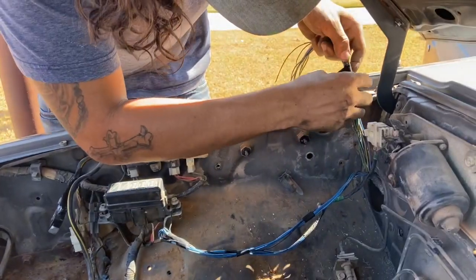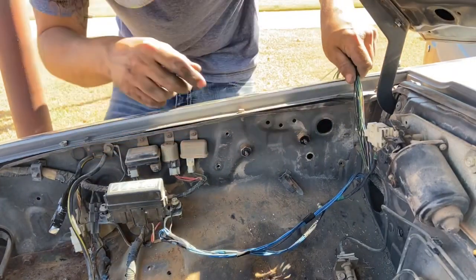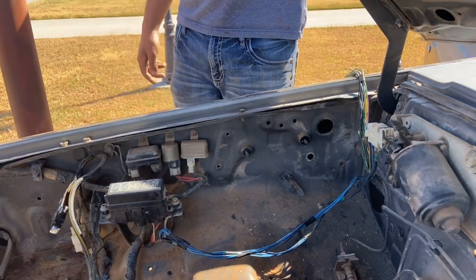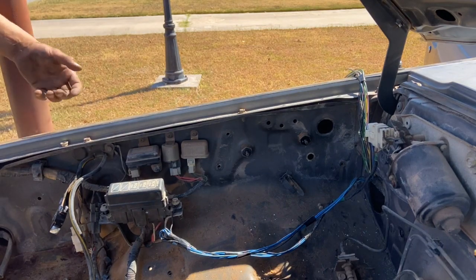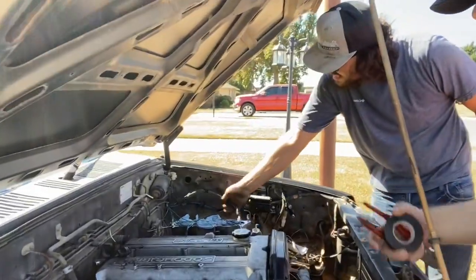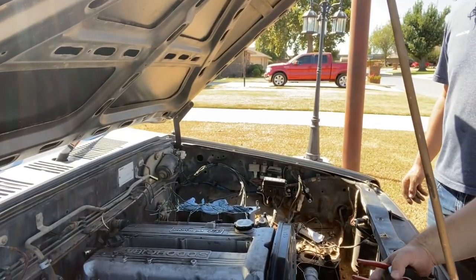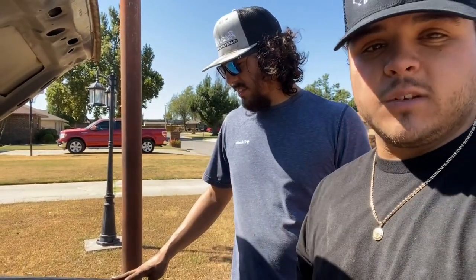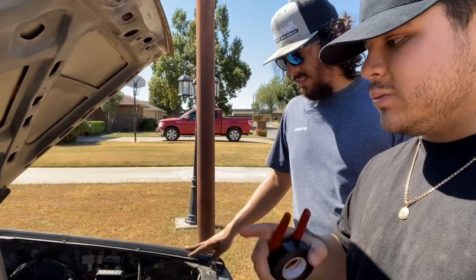You're gonna need your battery cables, your terminals - all the rest of that stuff was for vacuum lines and sensors you don't need anymore. This right here is all in-cab stuff we'll eventually figure out - some of this might power up our new ECU. This might be the power and ground for the old ECU, which we can use to fire up the new ECU so we don't have to run wires from the ignition switch. This thing is like bada bing bada boom - the most factory un-factory engine they'll ever put in here. We're gonna call it a day.